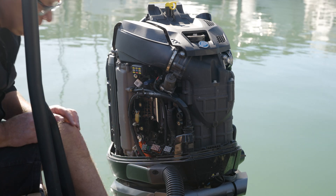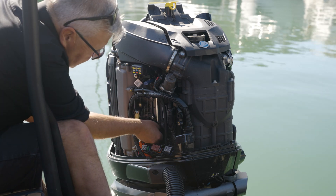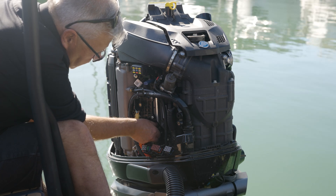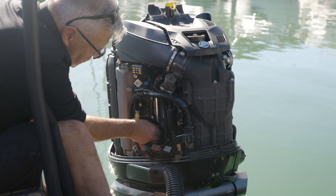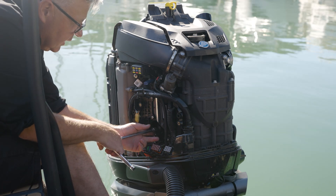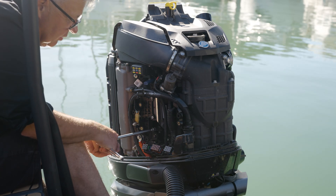In this particular case it's nice and easy — just take the knock sensor with the 8mm bolt and screw that in. A little bit of Loctite if you're putting it on permanently. Use a 13mm socket and move the sensor around to about 3 o'clock to 3:30.